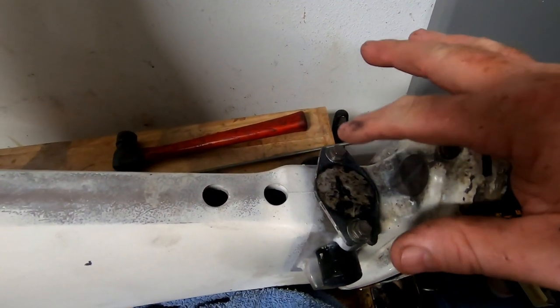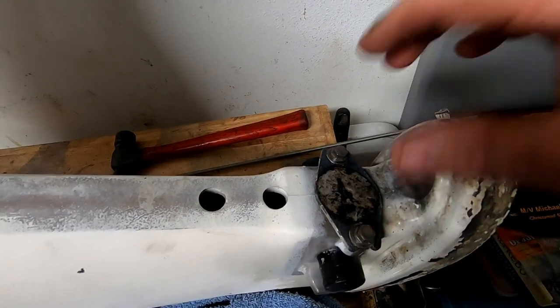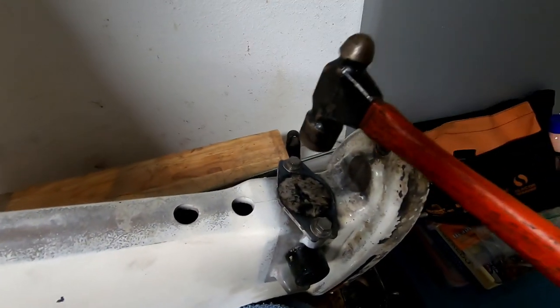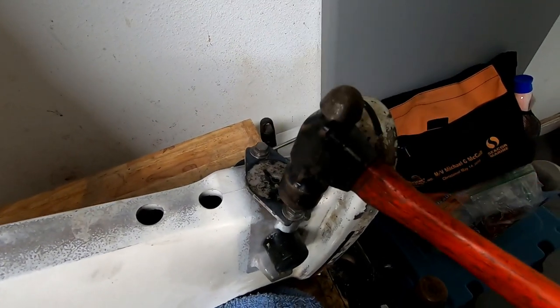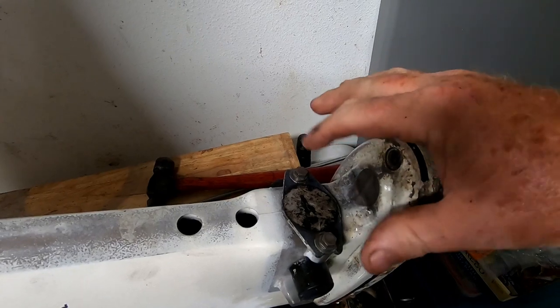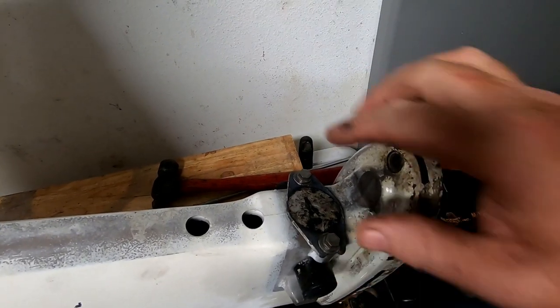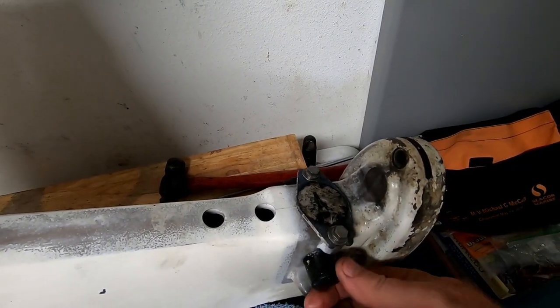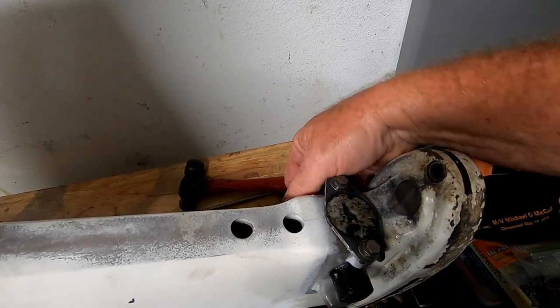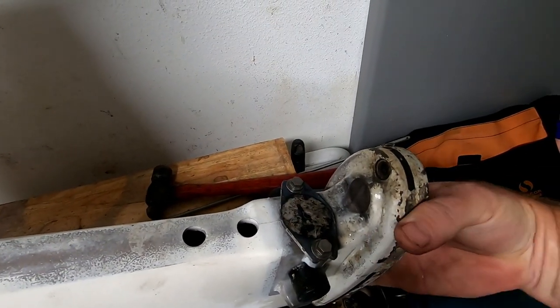The whole trick is to get this done without breaking the bolt. These two lower mount bolts are in blind holes and I've tapped them to shock them a little. They'll move back and forth like about a 30 second of a turn, but I'm going to keep spraying them. I don't want to put any heat on yet. I'll get into these side mounts — I might have to remove them and try some heat.